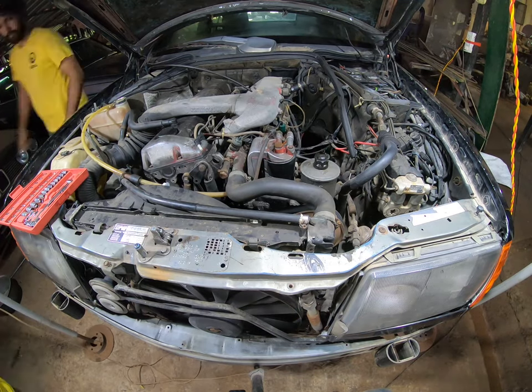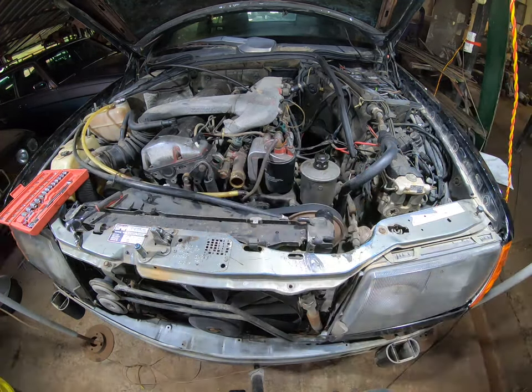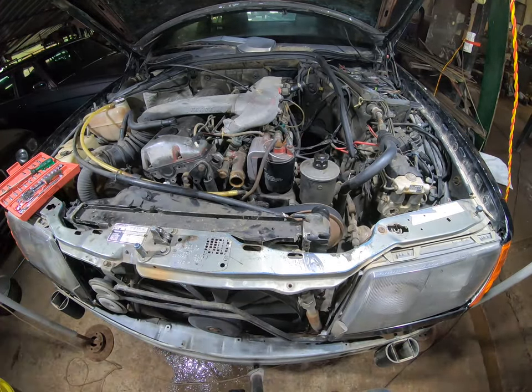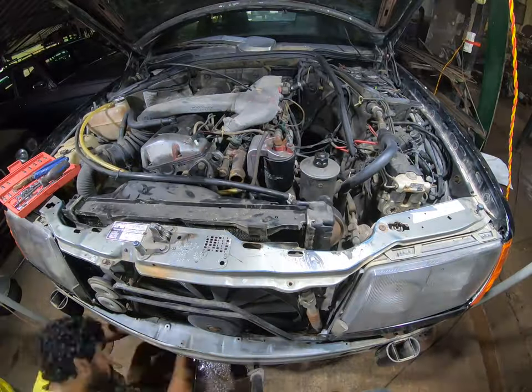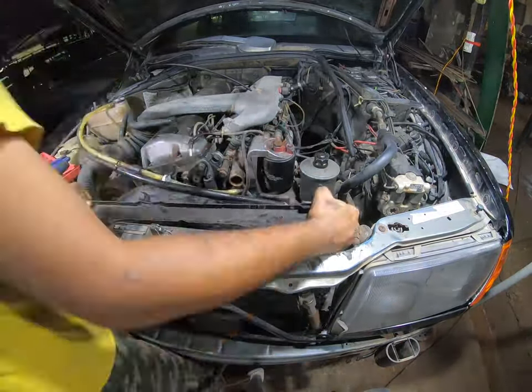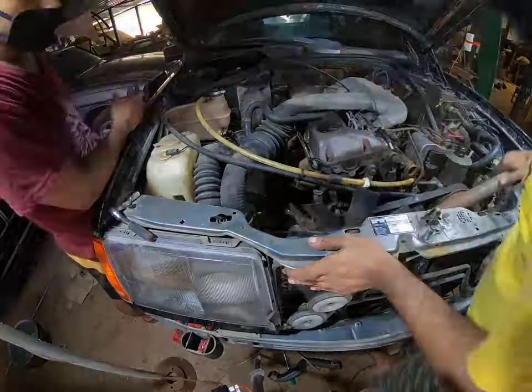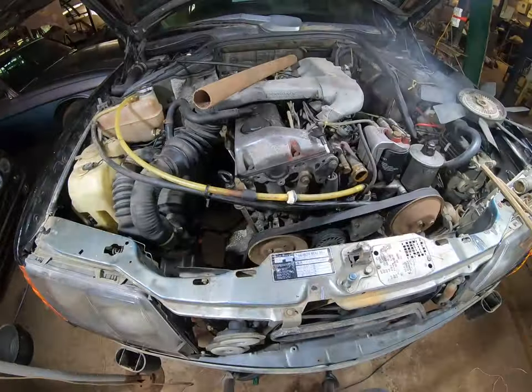On this episode of the Diesel Hammer, I'll be changing the water pump, the thermostat, and doing an engine oil flush. I'll start off by removing the radiator and fan shroud to be able to remove the water pump. To do so, I remove the hoses, then begin to unclamp the radiator and shroud.